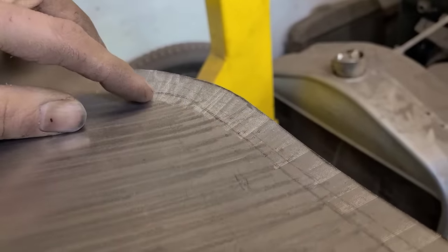As you recall, I cut this corner section out and then bent it by hand, and then I used the shrinker to shrink this edge so that it fits nicely there, or at least roughly close to where it needs to be. And then I also had to do a little bit of shrinking here to kind of curve around like that, and then that'll fit fairly good.